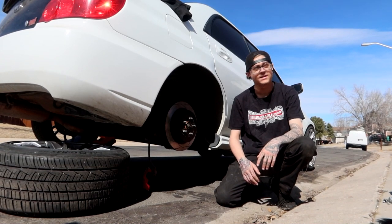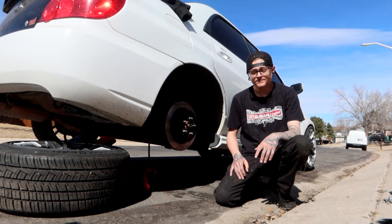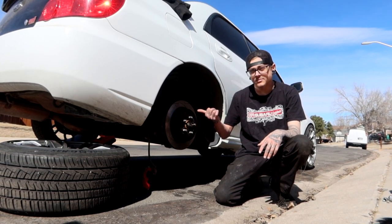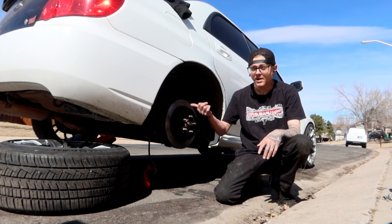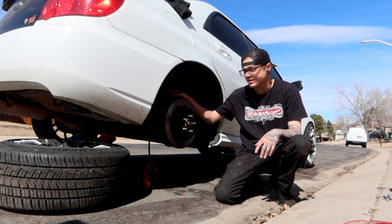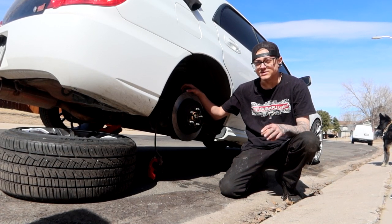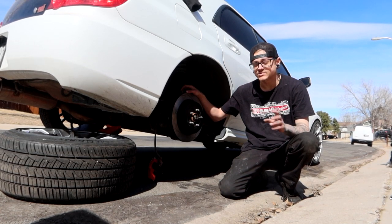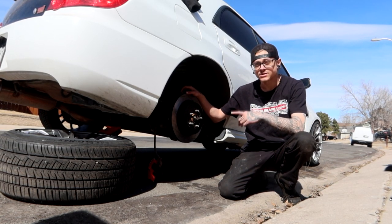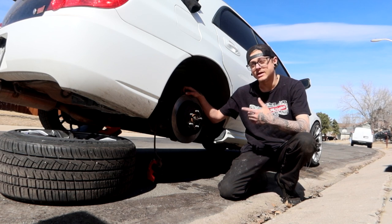So here we are about a week later. I think I just cut the lip off of the dust shield. Everything's fitted up — the dust shield doesn't rub anymore. I'm going to go ahead and throw the caliper onto the bracket, and then I'm probably going to have to run to the store to get some line wrenches, because when I was trying to take off the brake line it was starting to round out a little bit and wasn't breaking loose. I need to get a really good pair of vice grips or some line wrenches — probably pick up both just to be safe. Let's get the caliper onto the bracket, see where it sits, and then we'll get that brake line broken free and install the new ones.